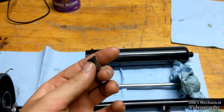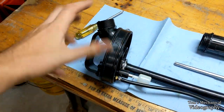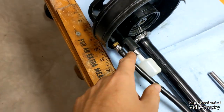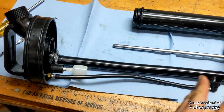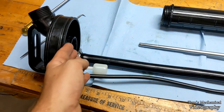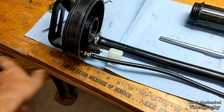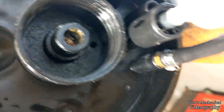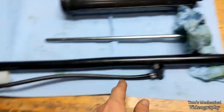Pull this spring off so that you don't forget it. There's also a check valve that sits down in there - pull that guy out too. There are two big o-rings up here; try not to rotate this thing inside of there because it'll bunch up the o-rings, just pull it up and out. There's an o-ring right here and also kind of a seal right in there. This is a float valve - if you fill this thing all the way up to this level this guy will float, go up in here, and jam that inlet that supplies air so you can pull air out and push it out through there.